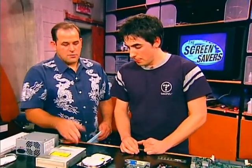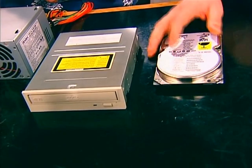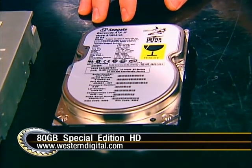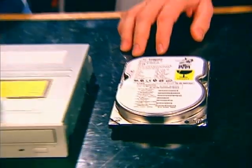You can use any hard drive, DVD, or CD — as long as it's a standard ATA hard drive and CD-ROM, you're fine. I went with the Western Digital WD800, their special edition drive with 8 megs of cache. It gives a nice 10–15% performance increase with that extra cache and works great on Macs as well.